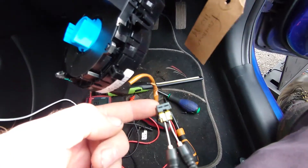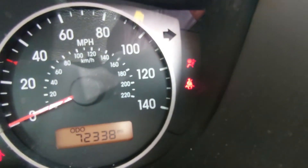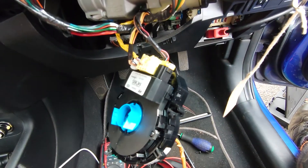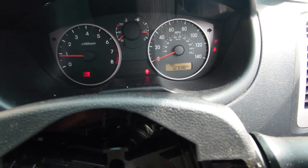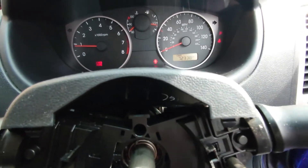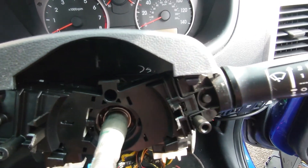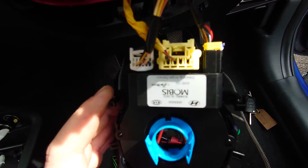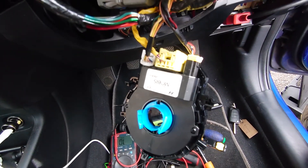The airbag light is on, clock spring is plugged back in, and we're back into our resistor all plugged in here — airbag light is still on, so we've definitely got an issue inside the clock spring. As I say, very doubtful on the airbag — they very seldom give issues, most of the time when people change them it's just for recalls. Be careful with airbags; you should follow all the manufacturers' procedures. There are some part numbers here, so we're going to get a new clock spring and that'll sort our problems out. Cheers guys, see you again.